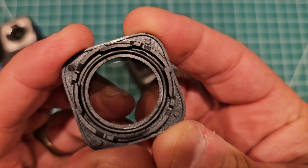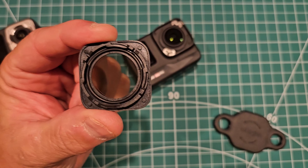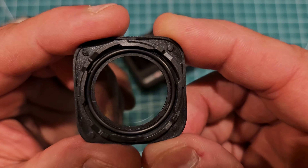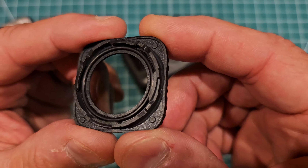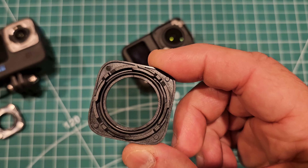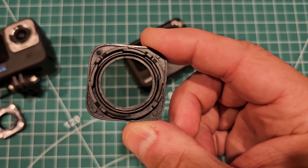The O-ring in the cover is what provides all the water resistance. So if you do take yours off — at your own risk of course — always check the O-ring. Make sure it's not pinched or flattened out. If it is, use a different cover. These are cheap — you can get them on AliExpress. You can get a pack of four ND ones and a CPL for $20, and a clear UV one for around $9.